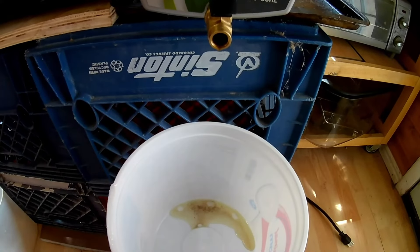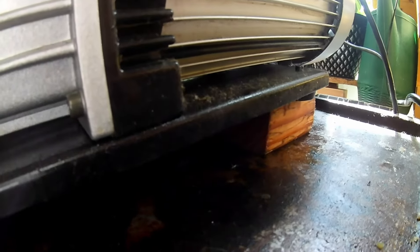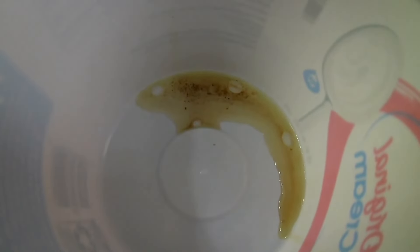Here's another tip I hope you'll take into consideration. Even after you drain your oil, I would suggest leaving your valve open and your pump tipped on a block. Even after several hours after draining the oil, I still recovered not only some oil but also water that was still in my vacuum pump. If that water wouldn't have come out, it would have mixed with the new oil - and oil and water just don't mix. We really need to keep water out of the oil as much as possible.